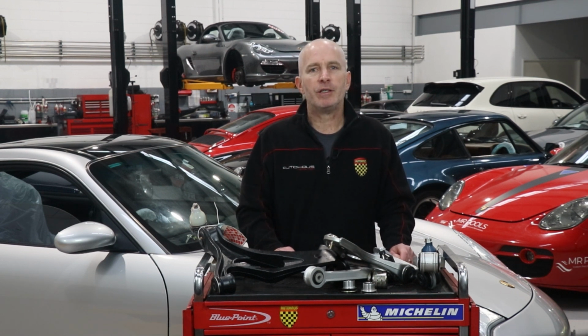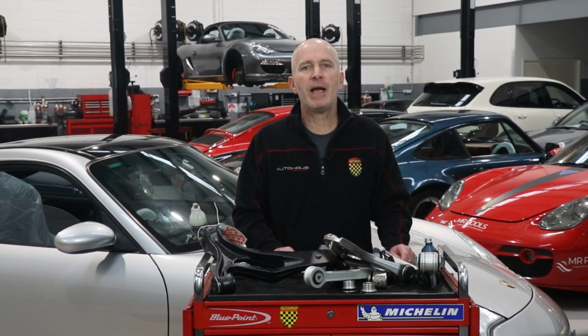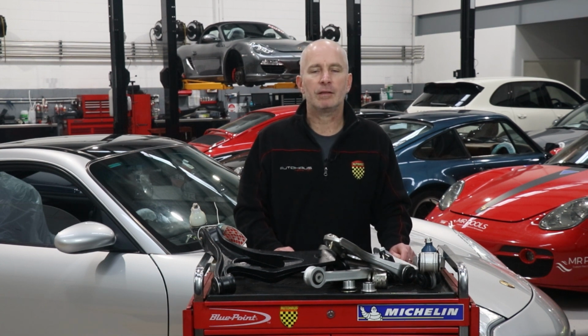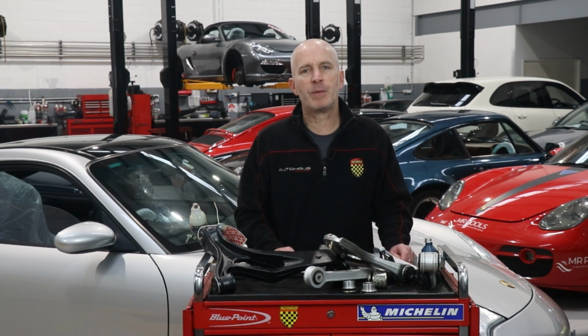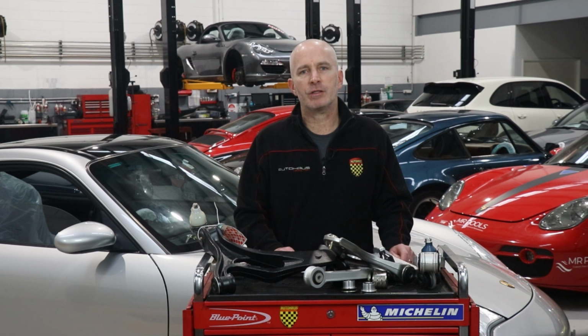The simplest suspension used by Porsche over the years may have been in the classic 911, and the most physically complex may have been the rear axle of the 993. The classic 911, like all subsequent 911s, used a McPherson strut system for the front of the car, with a rear suspension design that consisted of a trailing arm and a spring plate to connect the torsion bar to the rear wheel carrier. Simple and strong, in a sports car that made virtues of simplicity and strength.